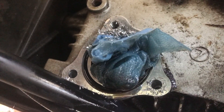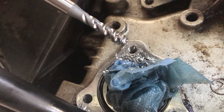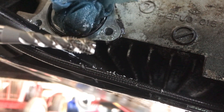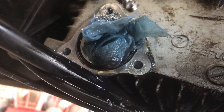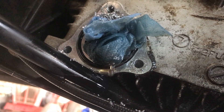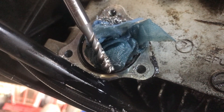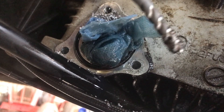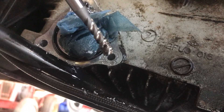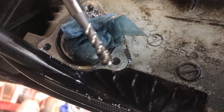The two bottom holes are still just drilled out, and the upper hole I've gone ahead and threaded with the tap from the helicoil kit. Make sure you use some lubrication on your tap, and keep the threads clear and clean — if you start getting a lot of chips bound up on it, back it out and clear the chips off the tap. Since oil is dripping out, I'm using engine oil as cutting oil. This is a cast aluminum block — or possibly magnesium, I'm not sure — but it's not real hard to drill or cut, so engine oil will be just fine.